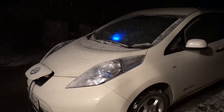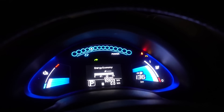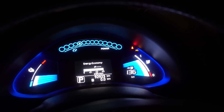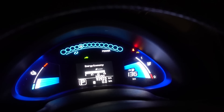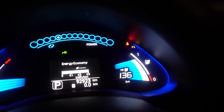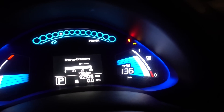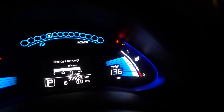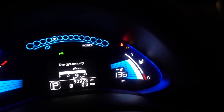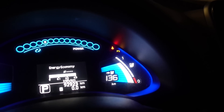The update is done and it's now charging — and it's snowing outside, which is Finland for you. The car originally came with a 24 kilowatt hour pack showing about 14-point-something kilowatt hours remaining and only 9 bars out of 12. This replacement 30 kilowatt hour pack is very healthy, showing full 12 bars. At around 70% charge, it's already showing much higher range numbers — previously about 100 kilometers max, but now likely settling around 170 or 180 kilometers in winter.